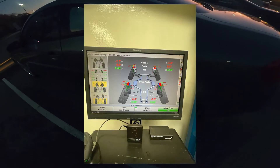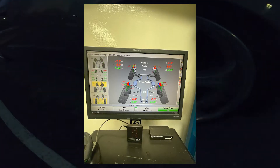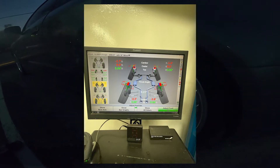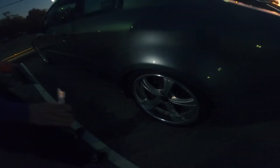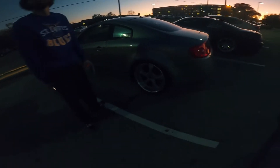Alright, next day — camera got corrupted, but it's all done. Rolled and pulled the rears a good amount and did the alignment. It's at about negative three degrees camber all around and the toe is straight, just to drive it, just to daily it. Also maxed out the front coilovers — they cannot go any lower.